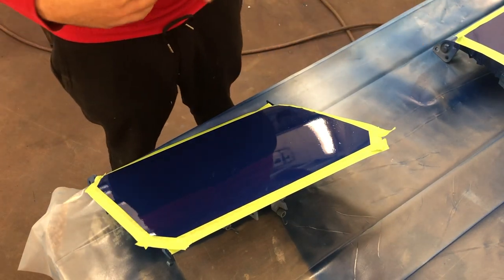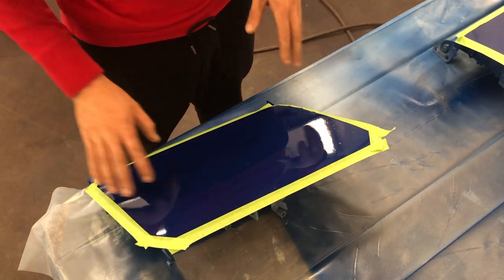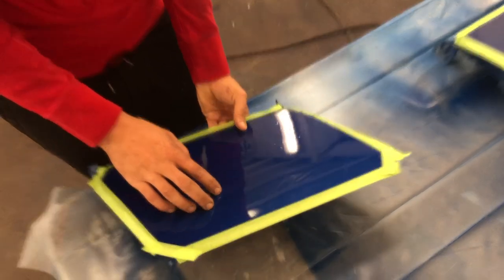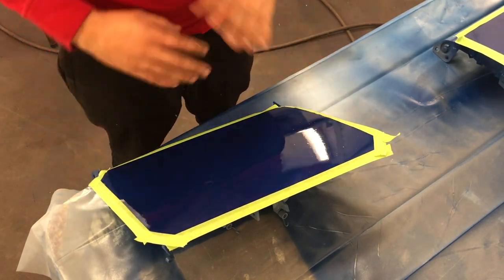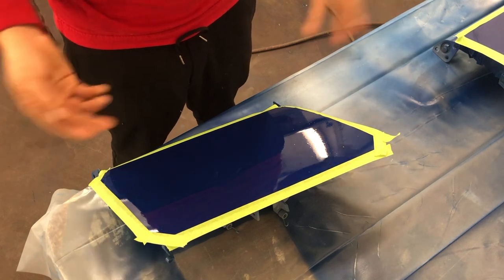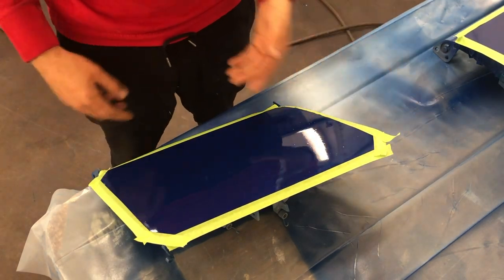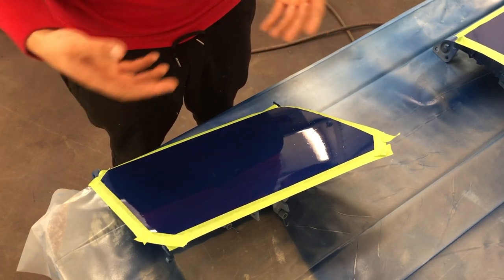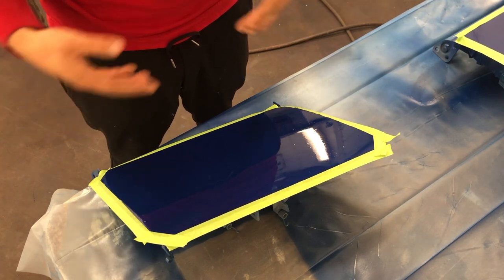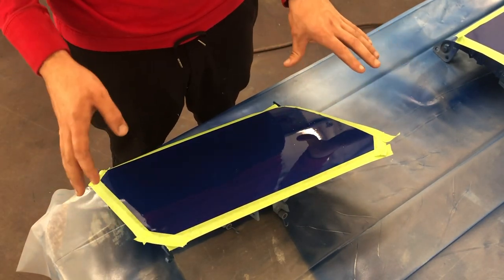To start the process, I'm going to start with these headlight buckets. I want to see how the 2000 grit is going to affect all this. I'm not going to hide anything — you can see the trash in it. At least I hope the camera's picking up the trash and the slight orange peel. A quick tip: if you are going to cut and buff, you can do this on clear coat or on single stage. The method applies to either. One thing I highly recommend is to tape off your edges when you're sanding. The reason is edges are going to get less paint — no matter what, they'll have less paint and less clear. Because of that, they're a lot easier to break through, or get the clear coat so thin that when you come and buff it, you burn through it. So tape them off. Save yourself the headache and the worry — that way you can go ahead and sand.